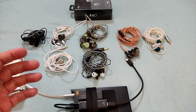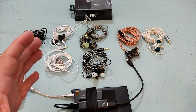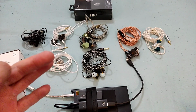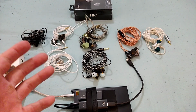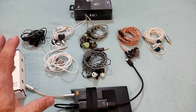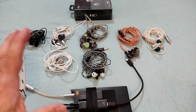The Rosefinch is just smothered with this ridiculous amount of bass, which, you know, actually the past 1K part of the signature is well done, but you don't even notice it. I retuned it, I lowered the bass significantly, and wow, what an amazing sounding IEM. And again, simple. Open it up, stick a Y5 or a Y6 filter on the driver, and that's that. It's done. It is that simple. And fantastic. It's a completely different beast.